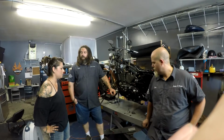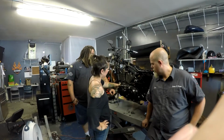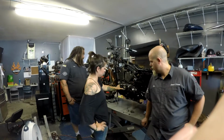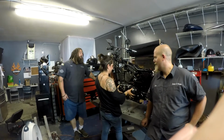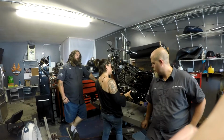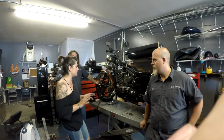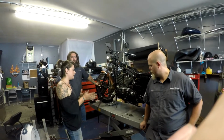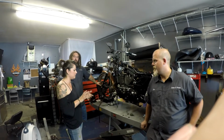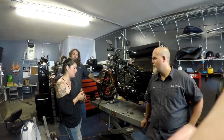So actually, that was all fairly simple, except for the fact that what's this guy called again on this side? Magnetic guy. Oh, the rotor? Yeah, okay, so the rotor is magnetic and extremely strong. So when you're going to place everything back on, as the guys told me, it's much better to align the chain back up into your cover first. Start to align this side, and then put this side on to make sure they go in nice and smooth, and keep the fingers out of the way, because when that thing plants down, it will skin your fingers. When I was taking it off and I was having to rock it back and forth, I actually did crimp the tips of my fingers a couple times. But when we got it back on this time, it was pretty easy. It was a lot easier than taking it off.